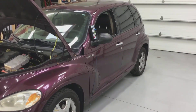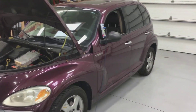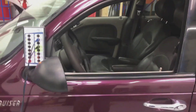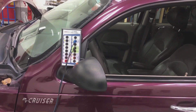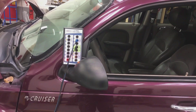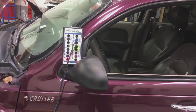We're doing the PCI bus today. This is everybody's favorite 2002 PT Cruiser. It uses a single wire network. It's what's known as a non-fault tolerant — that means if there was a problem in the network where it shorts out in one way or another, the whole network goes down. There's only one wire to communicate on, so when it goes down it cannot communicate anymore.